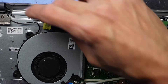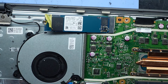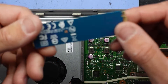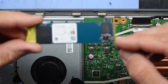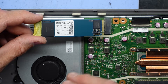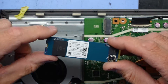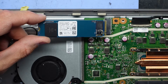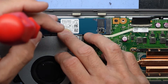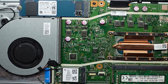Over to the NVMe drive — it looks like this has been user-replaced at one point. There's just a Phillips head screw in here. With the screw removed, similar to the RAM, you can wiggle it back and it's out — very straightforward. Note there's only one single notch on this drive. If you replace one, you'll either have to clone it externally to the new one, or clone off the old one. More than likely if you're replacing this, it's when you first got the machine, so you can put in a larger capacity drive and then install Windows from a Windows 10 or Windows 11 installer USB. That's what I'd typically do — put a fresh drive in and install the OS, then go to the manufacturer's website, download the software, and go from there.